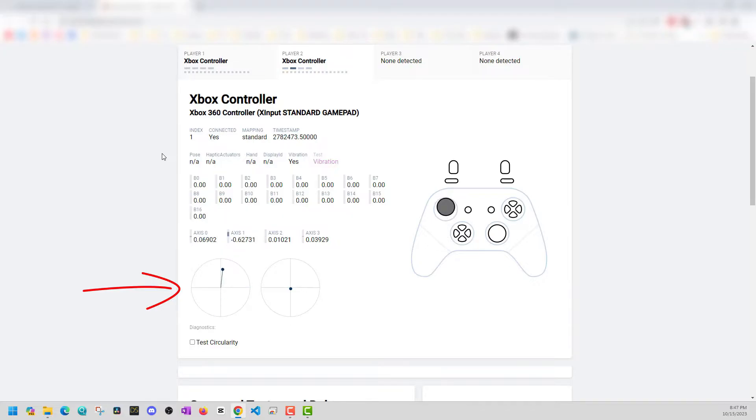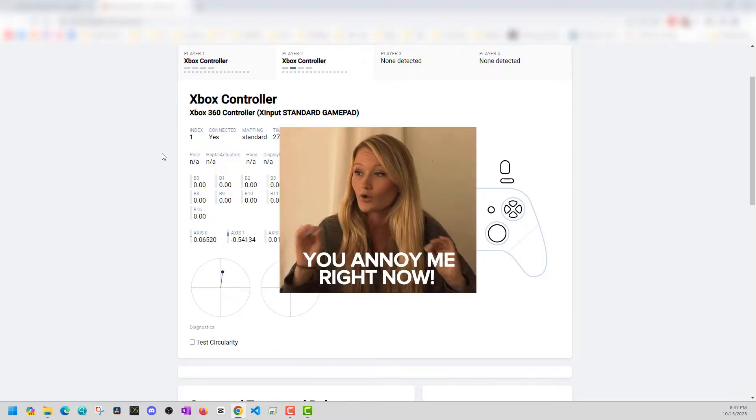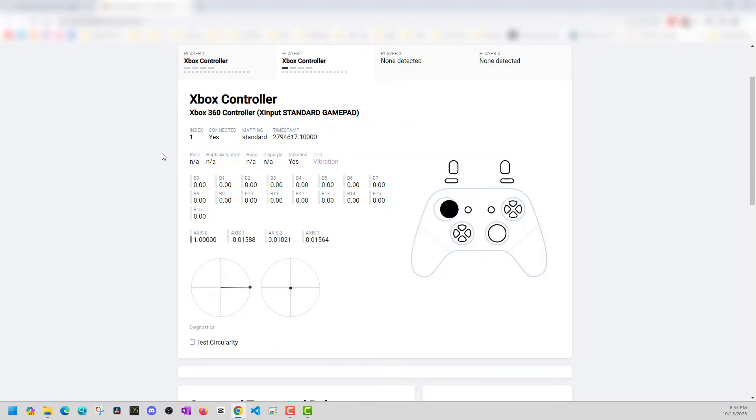This is the left joystick that is causing problems. I'll press up or down, release, it'll go back to center, but the sensor doesn't go back to center, which is causing severe stick drift and a lot of annoyance when playing games. So most fixes require you to open your controller up to get the dirt and debris out of your sensor area where your joystick sits.